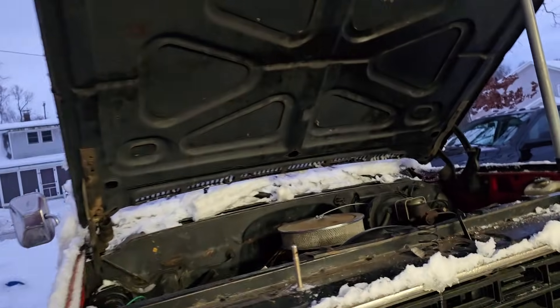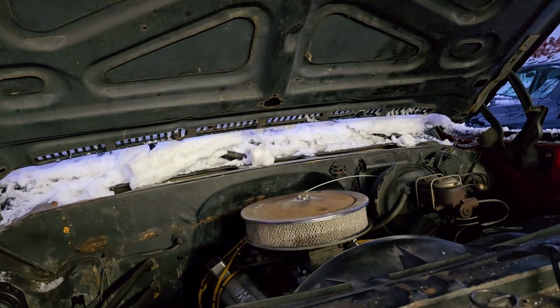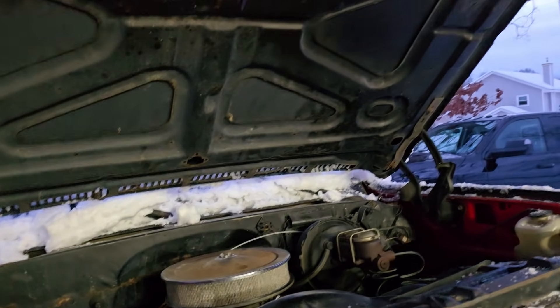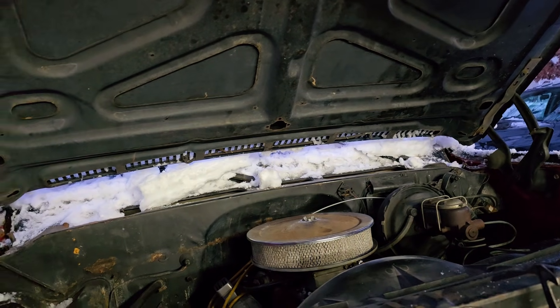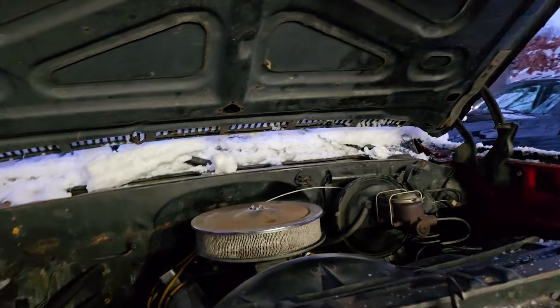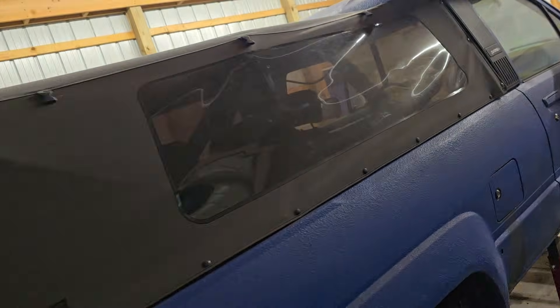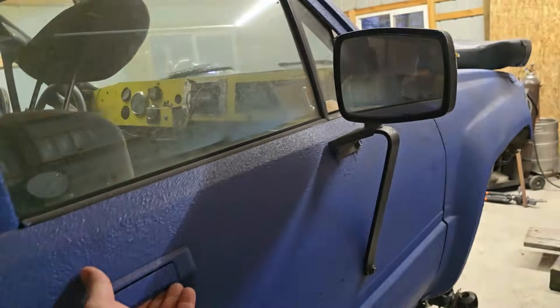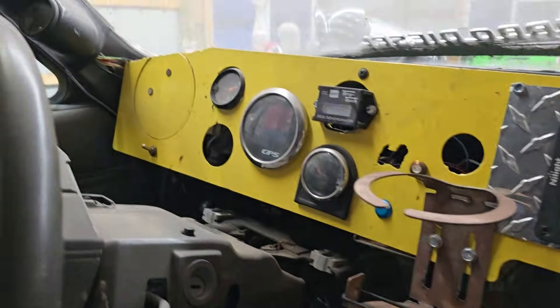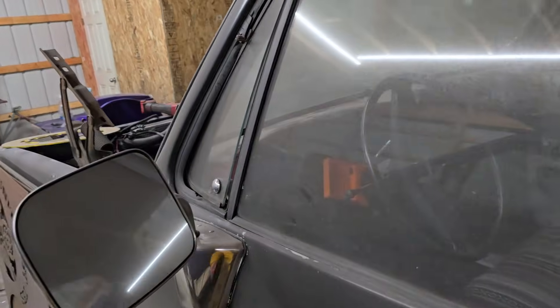Where it gets a little tricky is if you want a 4L80 in here but you have a mechanical speedometer and can't find a '91 speedometer or don't want to pay for it. Then you have to get a gear generator box — they're kind of expensive. Dakota sells them, I think Jarrett's sells them too. They're a few hundred bucks and kind of not worth it in my opinion. What I would do — what I did with the Toyota — is one of these eBay GPS boat speedometers. This one's digital, but they make them with a swept needle just like a normal gauge. You can't tell them apart; it would fit right in a square body dash. They have a little lag when you start up, but otherwise they work fine.